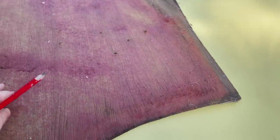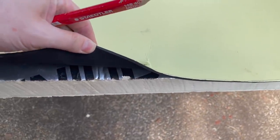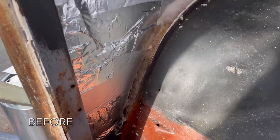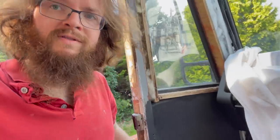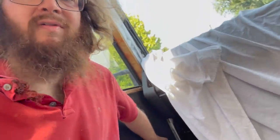This is the existing panel from the bottom that I'm going to reuse and carpet over, obviously on top of all this horrible glue. This is closed cell foam, which is good for absorbing sound and will provide an extra layer of insulation. So I'm going to draw around this, cut it out and stick it on top of the foil insulation before screwing this back in place. What I did is cut it to shape, peel just the edge off, jam it in there and peel the back off. Learned through trial and error — don't peel the whole back off and try to stick it on. Bottoms on.